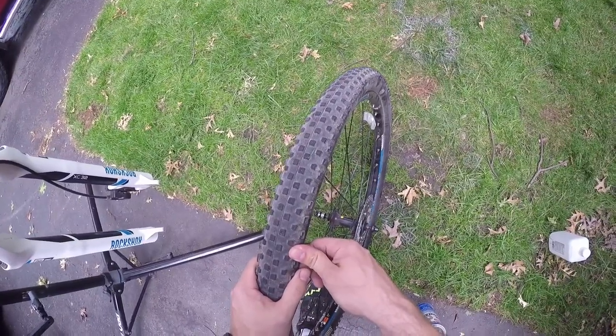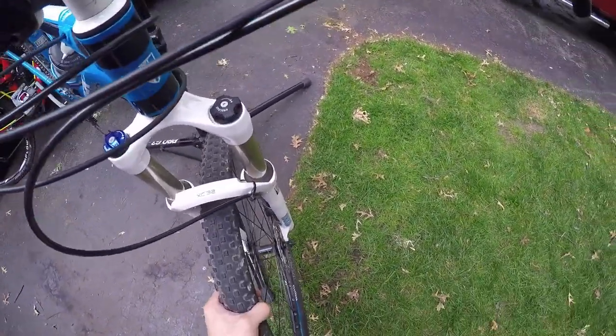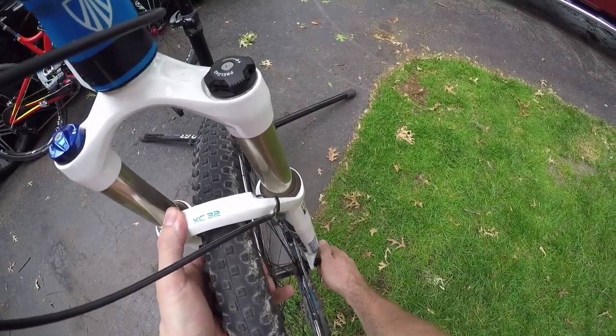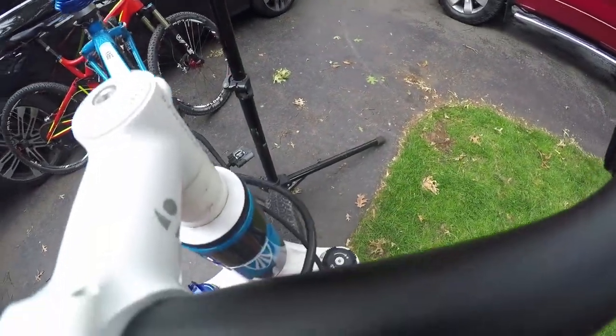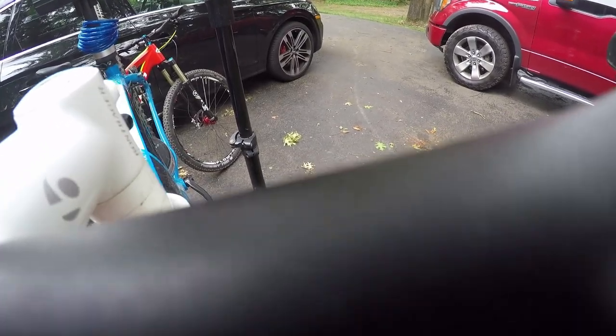How are we going to do that? It's going to be a workout. We're going to get on the bike, hold the brake, and pedal. You're going to burn some calories and work on your legs while fixing your bike. The first time we apply the brakes and work this compound in, it's going to squeal probably worse than before - so be forewarned. It doesn't mean you did something wrong, it's totally normal. As you work this stuff in and contaminants bake off and the rotor gets hot, the squealing is going to go away until, if we're lucky, it's completely gone.